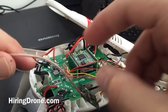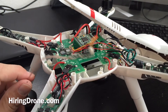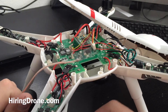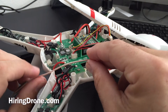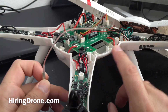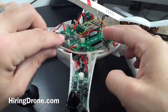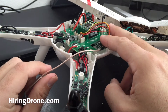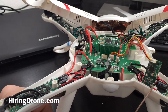Some people did say to try to increase the range, because I'm having an issue where it goes about 50 meters and then the red light blinks on and it goes into a weird return to home mode where I can still kind of control it. I have to limp it back to me, and then once it syncs back up with the transmitter I'm able to fly again. Some people were suggesting trying to relocate the antenna on the quadcopter. It goes standard down in the bottom right leg — motor 4. Can't put it there because the sensor's there. I could try to put it over here but then it'll be loose inside. But it leads me to believe that it is my transmitter that is the problem.